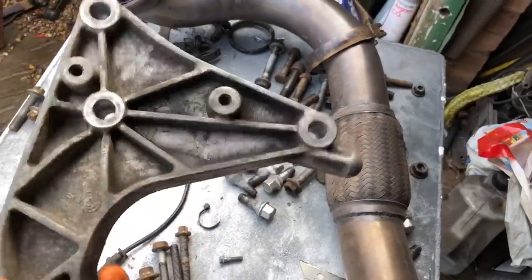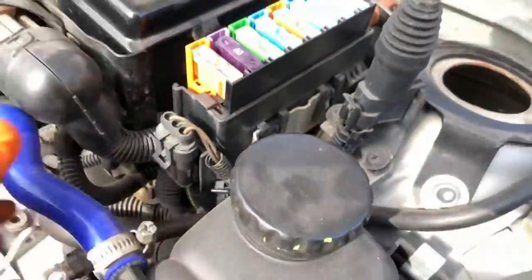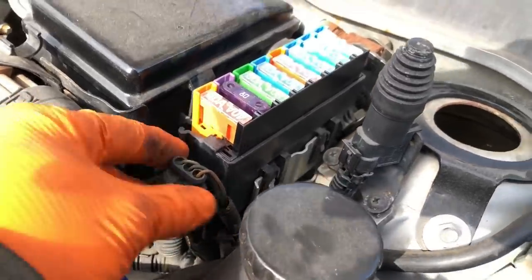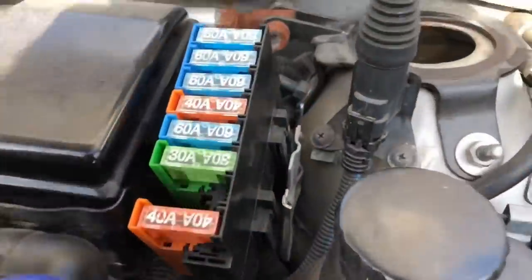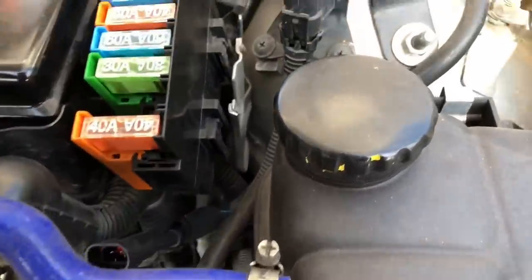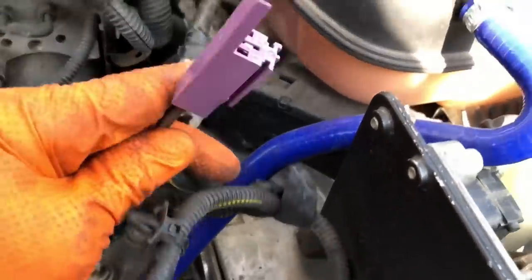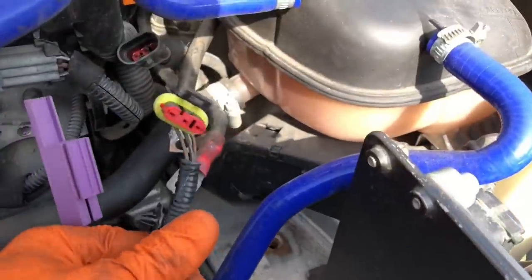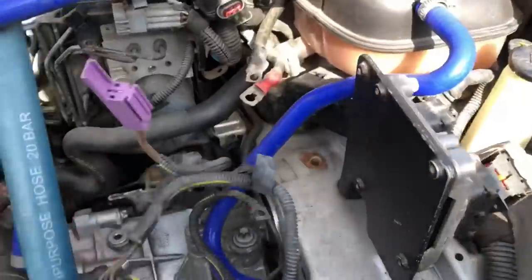It's a little nightmare especially if you're on your own. I've just removed the downpipe, the rear alloy mount off the back of the subframe, and the torque mount off the subframe as well. Got to remove the power for the steering rack pump — there's a connector here and then another one. Just disconnect that. Another one in the fuse box — the fuse you're taking out is the 80 amp purple one. These just slide upwards, don't try pushing them downwards. They slide up and pull out in halves. This is all the wiring for the pump: one's the earth, one's the power to the pump, and that is the trigger switch.